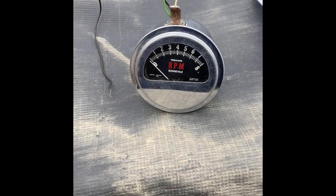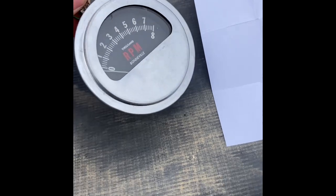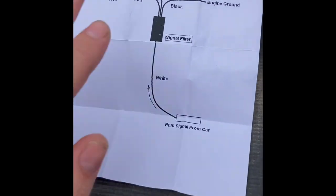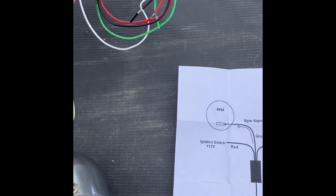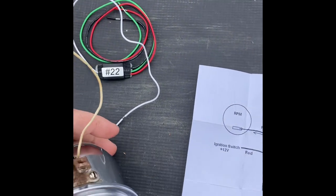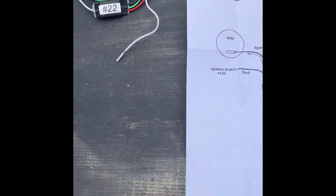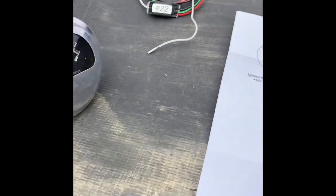In today's video I'm going to be trying to wire up this RPM gauge and get it to work. With points ignition these older ones will work, but these new ones - they try to tell you that you have to pay $400 or whatever and have it separated where you can run them with the HEI distributor. A good buddy of mine told me about this - it's called the RPM gauge signal filter. This little box filters the signals and makes it so the RPM gauge can read it. Without a signal filter, even on an 80s Camaro, that won't work.